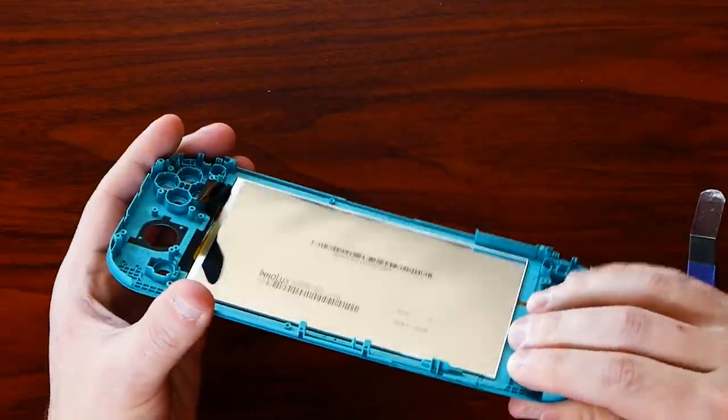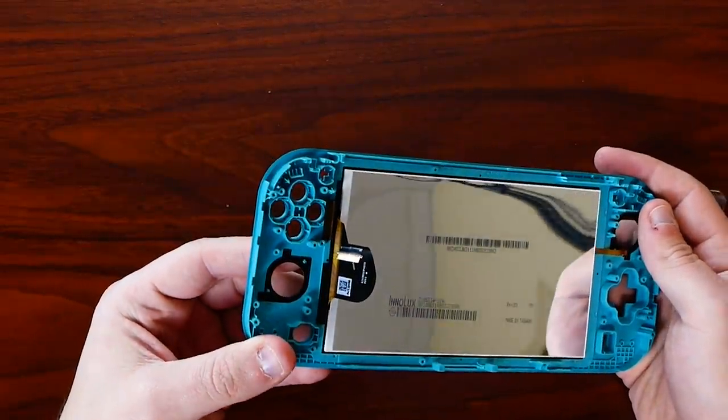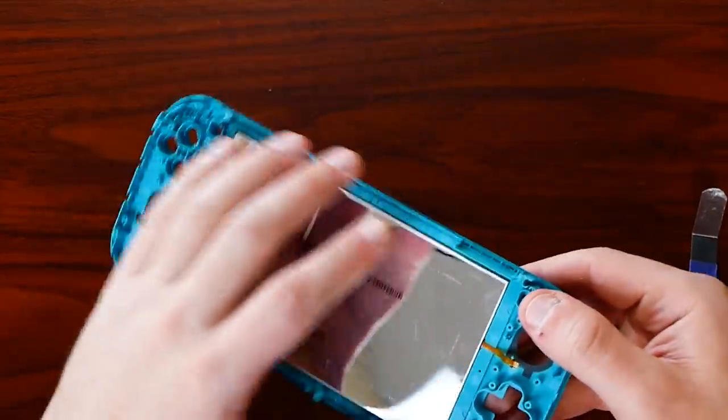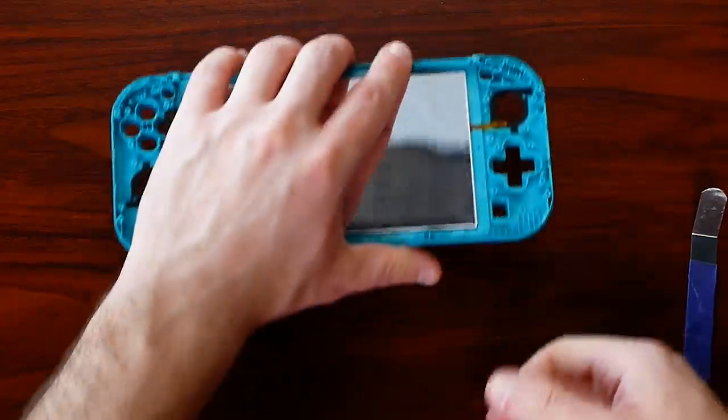It can take some abuse. It's going to sound terrible as you rip it out because you'll hear cracking and stuff as the plastic bends around it in the frame. As long as you're not too crazy with it, it should come free. Don't push directly on the back of the screen — do it around the edges. As the screen starts to come up and you see the plastic bezel lift, get a playing card, business card, or old credit card under there to dislodge it and pull it free.